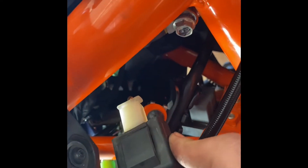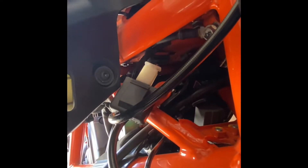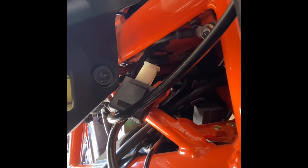I just pulled the flasher out — still attached. It's a little difficult as it's got a little clip on it to hold it in place. It clips onto that little rubber piece right there, which is then clipped onto a little flange. I'm going to disconnect that, put in the new flasher, and then show you what it looks like with just the regular incandescent US flashers.